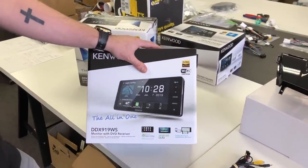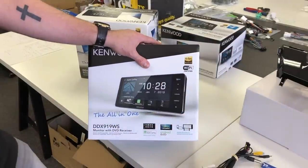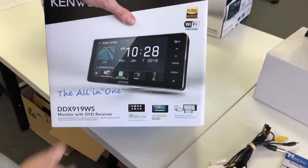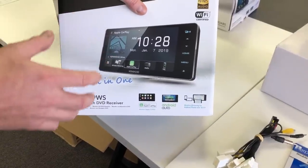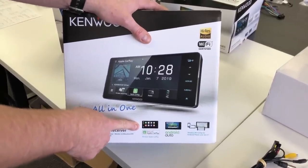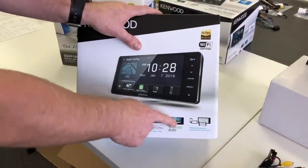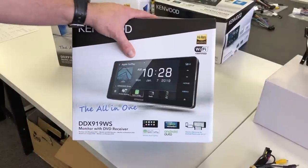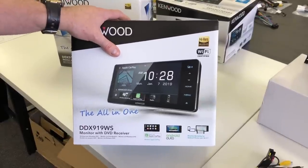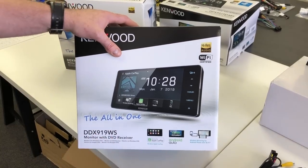The wireless smartphone mirroring, whilst previously a couple of years ago did work for Apple, now only works for Android, which is a two-way mirroring. A new addition this year is actually wireless Apple CarPlay, which is going to be available in Australia. There is a slight difference in the wiring of the looms in order to make that wireless — you can still use it through USB and get CarPlay, but to use the wireless Apple CarPlay there is a new VSS wire which must be connected. Android Auto will still work wired at this stage — it is not going to be wireless because Google haven't released it on all phones in Australia.